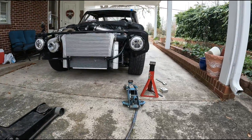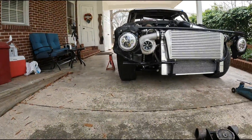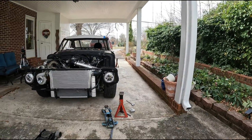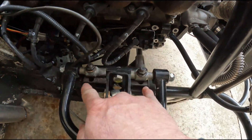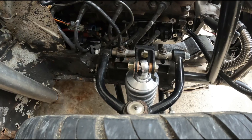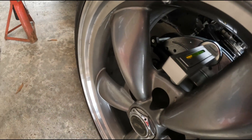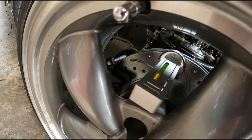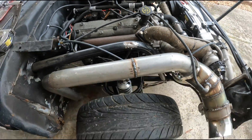Back on the ground, and the camber is way off — measuring about three degrees. From what I've read, most people shoot for around zero degrees. To adjust camber on the Mustang II, you just loosen two bolts and the upper arm moves in. After adjusting back about a quarter inch on the top, I'm now at about one degree positive camber. I'm going to look up the stock specs rather than just going off zero from the internet before deciding whether to tweak it more.